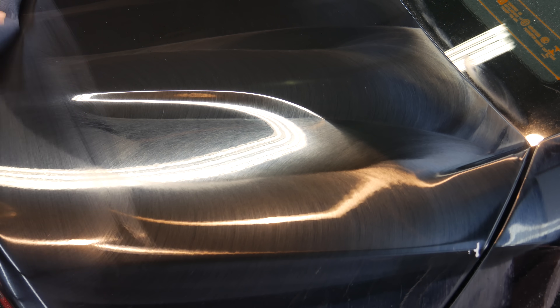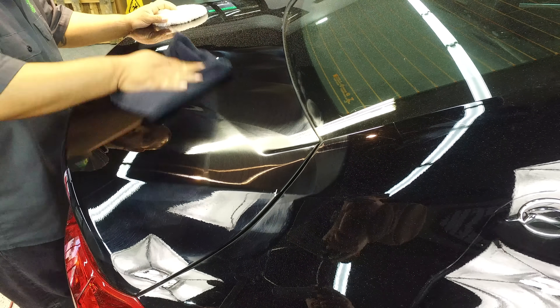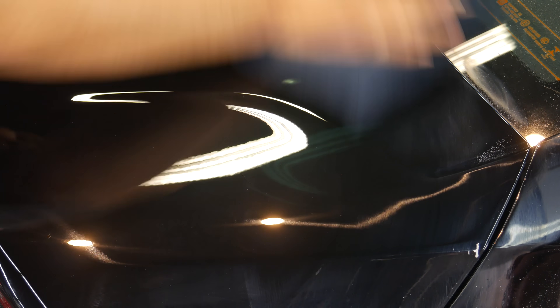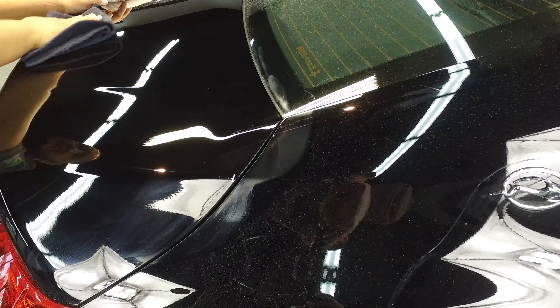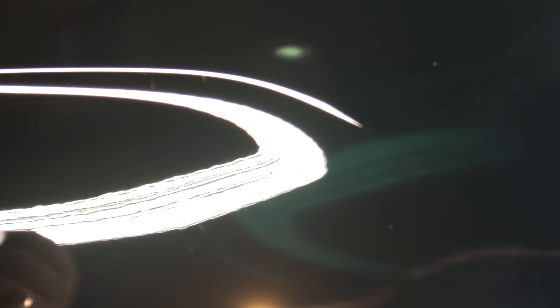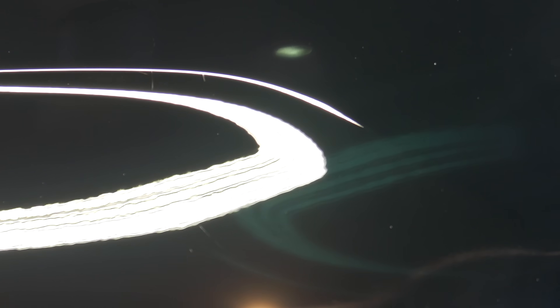And we are just about done. Now that we've completed the polishing process, we're going to take a nice clean microfiber towel, make sure there's no debris in it, fold it over and wipe it off in even back and forth motions. Wipes off easily. Wow, look at that shine — looks fantastic. There's no other scratches on there. Looks like a new car should. That's where the scratch was — see that it's gone. Got a nice, clean, flawless finish without any scratches.